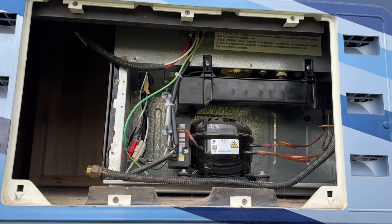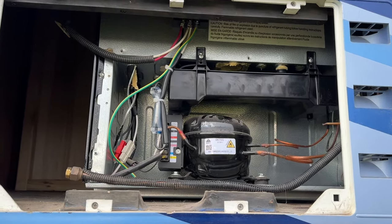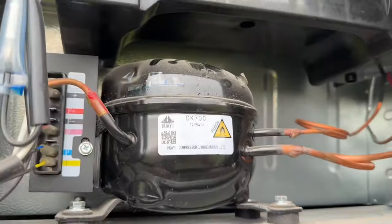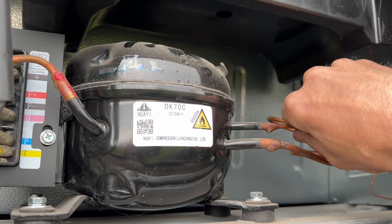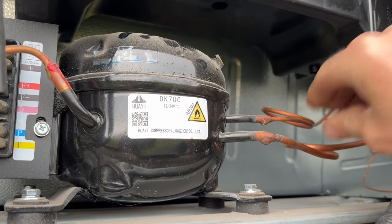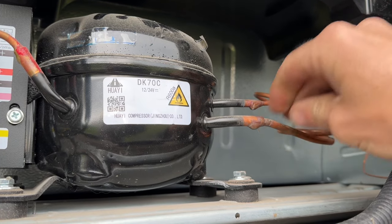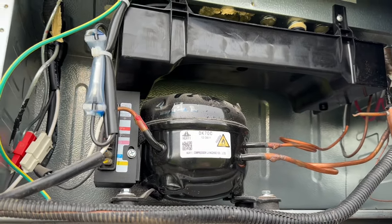I've got this access panel on the outside of my motorhome. Compressor fridges don't need this, but it's handy in this case. You can even see the propane line from the old fridge that's not used anymore. I can hear the compressor running, and if I feel the lines, the small one - the high side - is a little warm, and the low side is a little cool. It's not cold, but that is the way it's supposed to be. The high side won't be smoking hot, so we're good on the compressor. We're going back inside to pull a panel out.